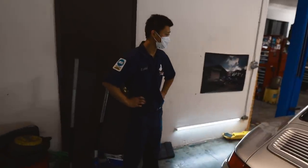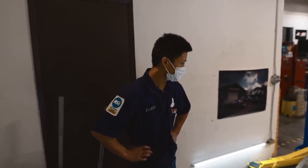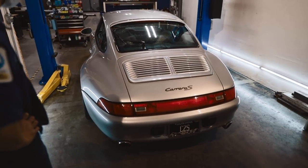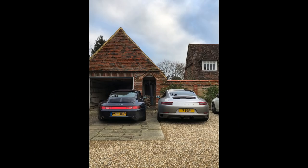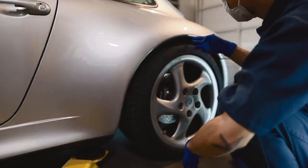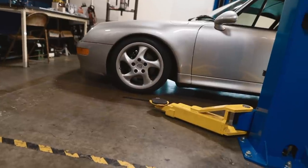Just pulled the car into the bay. Ezekiel, what do you think about the activities we have lined up for today? Thanks again for the opportunity — you always have something cool for me to work on. It sounds like a Porsche — the doors and stuff open like a German car should. We just talked about how modern cars are all fat and bloated. If you pull up like a modern 992 or 991, it's so much bigger of a car. The car right now is too high — the front's not bad in terms of the wheel gap, but the back is a little too high. Ezekiel, what do you think about that gap? No bueno, that's too much. So the first step is to lower the car, get things even, and then after that we're going to bust out the scales and give it a proper corner balancing. Finally, I am corner balancing a car on Corner Balance.